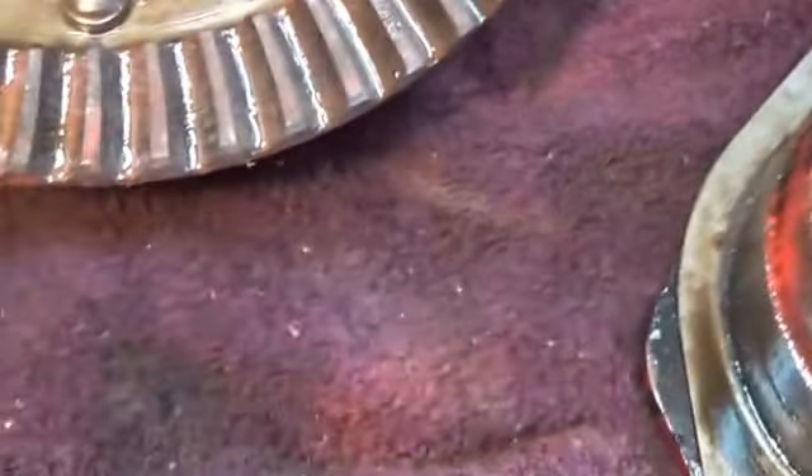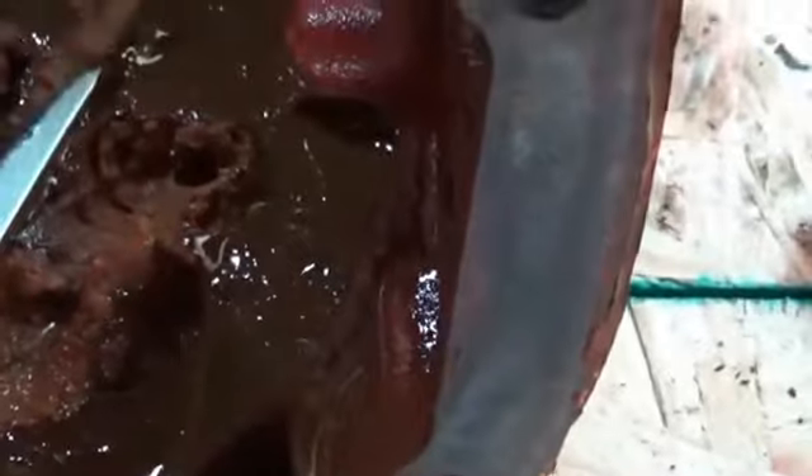The differential in itself looks okay — I didn't see any missing teeth. The case on the inside of the differential is rusted — chocolate pudding — and that may be the result of that oil-throwing gear that was destroyed. This guy right here supplies oil to the back of the differential. If that thing was busted, not enough oil was getting back there, and that would account for the massive amount of sludge.